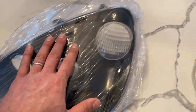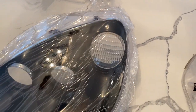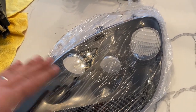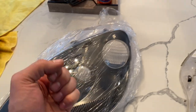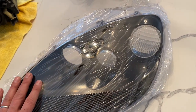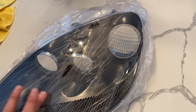Try to clean as fast as you can. No solvent, no soap — just a nice slightly-wetted microfiber. Wipe everything down or blow everything off because the inner coating is super easy to damage and scratch — you will leave smear marks. The coating becomes soft and pliable over time, and without actually stripping everything, removing, reapplying primer, and repainting, you're going to end up with this. But this is still a very good inner bezel. Don't go in there trying to rub things off because it will literally take the paint or coating right off and you'll have bare spots everywhere.